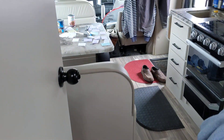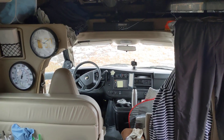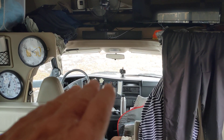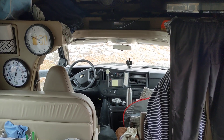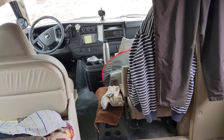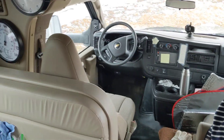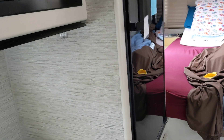Whenever you're leveling your RV, no matter what type it is, these things twist. They're on a beam frame and all that stuff. You may have it perfectly leveled in the front where your levelers are — your gauge or whatever you've got on the side says it's all perfect. But then you get inside and the doors just close on their own, or they keep swinging back and forth. So do the door test, do the shower water test, and whatever other test you want. The bathroom door test gives you one axis, but the refrigerator door gives you the other side — you know what I mean?